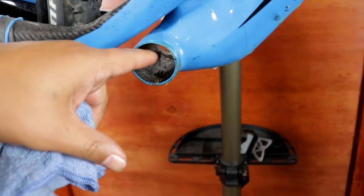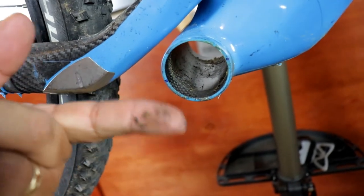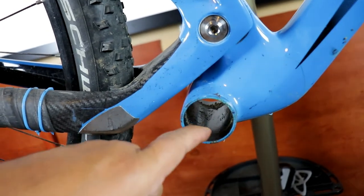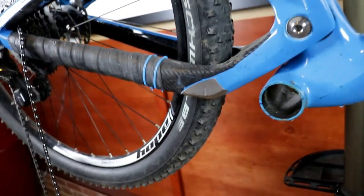We've got the old bottom bracket out, and I want to show you how dirty it is inside and why we got moisture, expansion, and why it was creaking so much. If I put my finger right in there — look at all that dirt and grime. You can see all the dirt accumulating through there: grease and dirt that got in just from riding, probably because I didn't have a good enough seal on the inside of the bottom bracket. What we have to do is put the new bottom bracket on, then put some Loctite to make it stay in place and prevent water from getting into the frame.